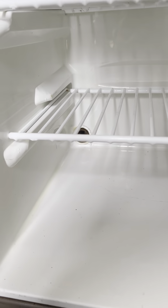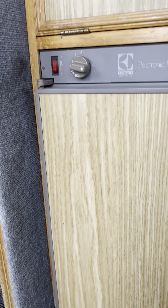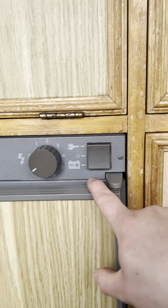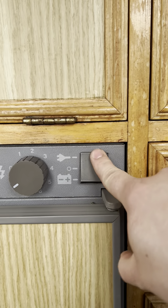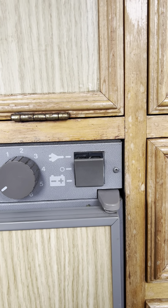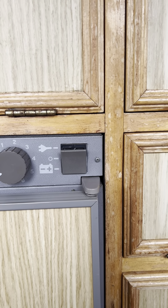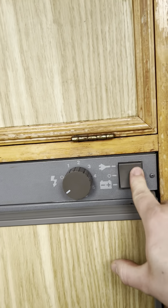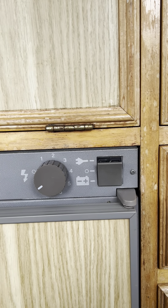There's a little plastic cover in the bottom left-hand side of the fridge. When you light it up on gas, you'll be able to see the flame lighting up inside that little peephole. On the right-hand side you've got your electrical side. If you have the electric hookup plugged in, you can press the electric hookup switch and that'll cool the fridge via that. If you've got the engine running, you can press down and that'll keep the fridge cool whilst you're driving. You need to pre-cool it before you leave either via the gas or the mains electric, and then switch over to 12 volt just for when you're driving.